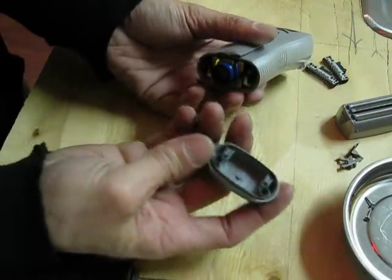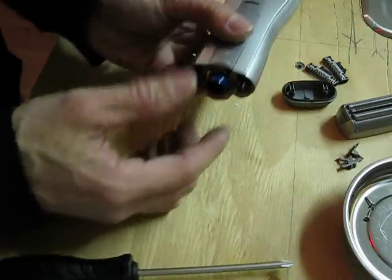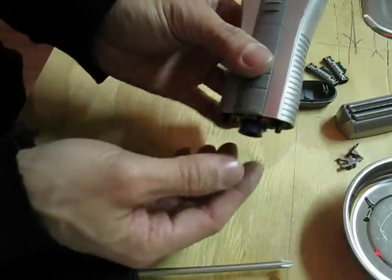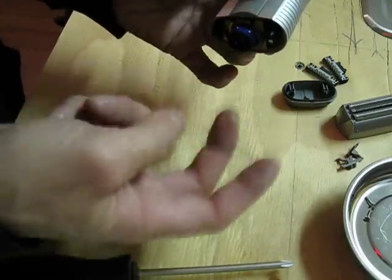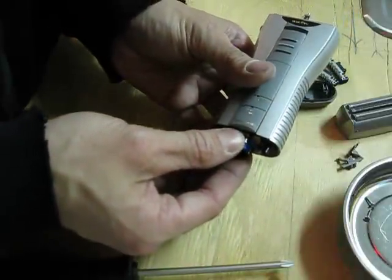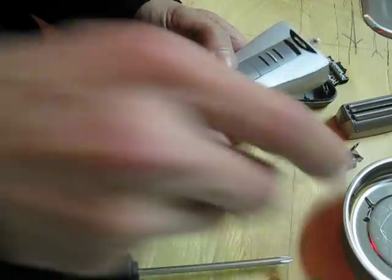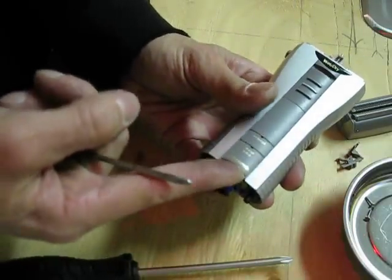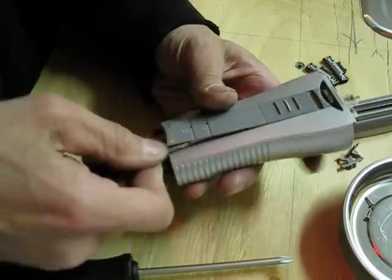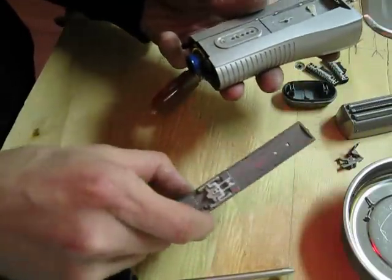The tail cap here — you see this little O-ring? That's what keeps this thing waterproof. This is a wet/dry shaver. It has this little inductive coil here — this is how it charges, so it stays waterproof. Obviously there can't be any type of metal contact for it to be waterproof. So I need to pop this housing off here — basically just go in there and gently pop it off, and the whole piece comes off.